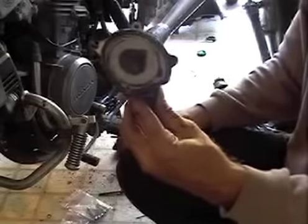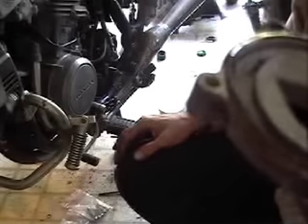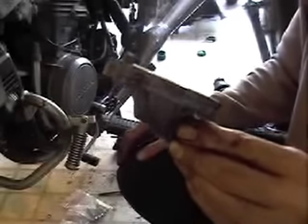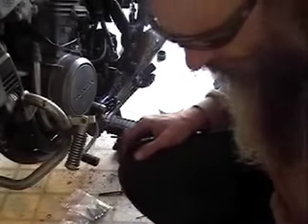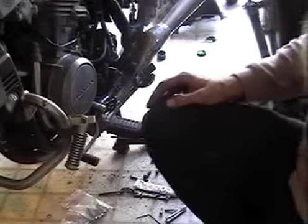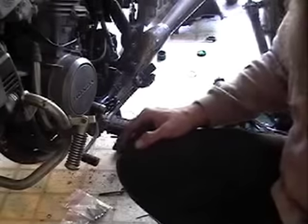When they could've took a penny's worth of Indian Head and two seconds of extra time and just let it sit for a minute. And that O-ring will stay in there with that Indian Head Gasket Shellac. If you put it on thin like I did, you ain't gotta worry about it — that is just real thin. I got a little glob on there in one spot, but that ain't gonna hurt nothing, it's just gonna make it seal better. Let that shit cure up and get hard before you put it on though. Anyway, that covers that base.